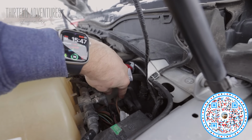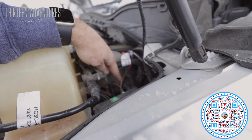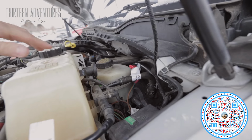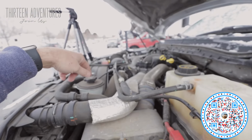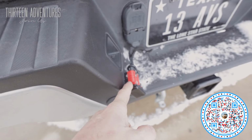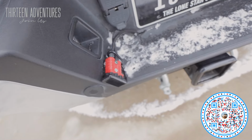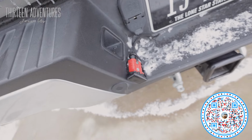So you can see the 40 amp wire. So this is number five wire. It's the brown wire with blue stripe. It goes into that self-resetting 30 amp fuse. On the other side of that, it goes out and goes down and follows the same path. Got my new AGM batteries here on both sides. The negative wire is right here. I self-tapped it into the frame rail right there. On the block itself, I had a thick piece of plastic here, probably a quarter inch thick, and that's what I used. I cut it out the same size as this red cable, put it right behind it, both wires coming out, and this system works really great.